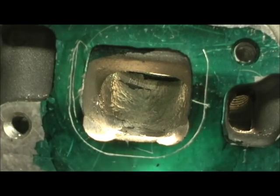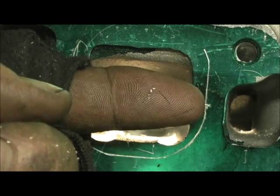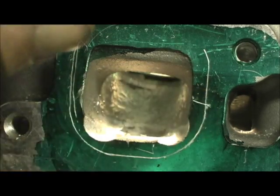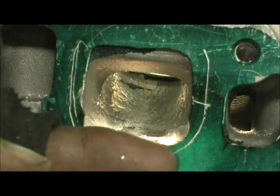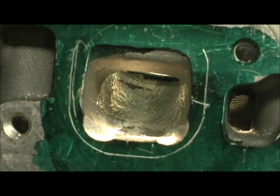To turn this into a race head, I would go in here, weld the meat up to about right here. This is just textbook. I'd weld off that area there at least a half inch, come up, bring it up, and right there I'd probably pick up 50 foot pounds of torque.